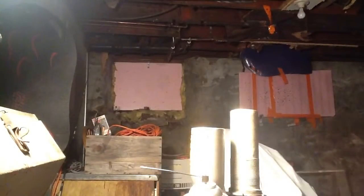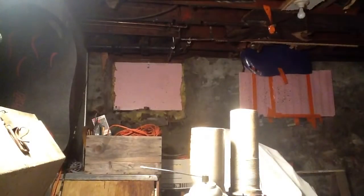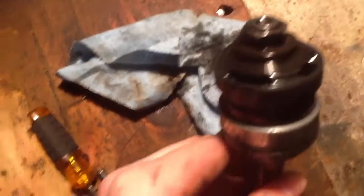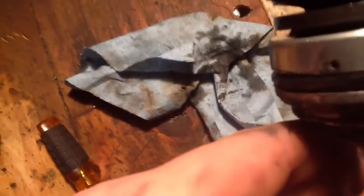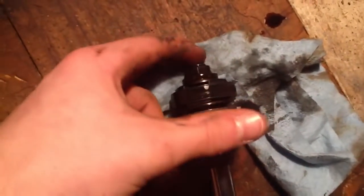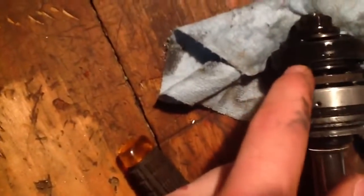There's a little smoke coming out — holy shit. So that was what we were after. Let me show you guys — this is pretty disgusting. This is the head seal that is completely shot. This washer is shot, that's why it was so easy to pull out — I could have done that one-handed. This shaft doesn't have any peening on it, it looks like. Someone has definitely rebuilt this but I don't see the peening being ground off at all — it might have been. But normally, especially on my shock, there'll be a little more threads here and they'll extend out. So you have to grind them down so you can get the nut and all the valve shims and everything off and get it all apart.